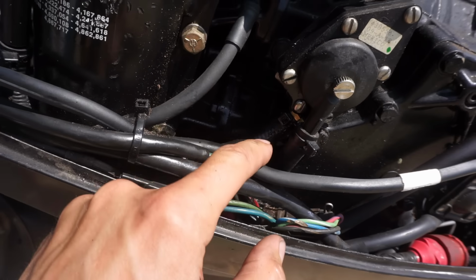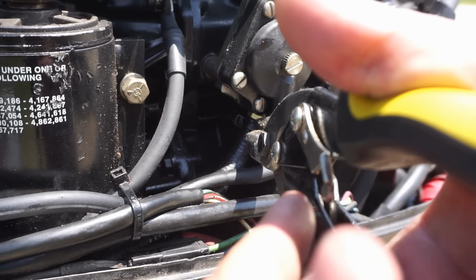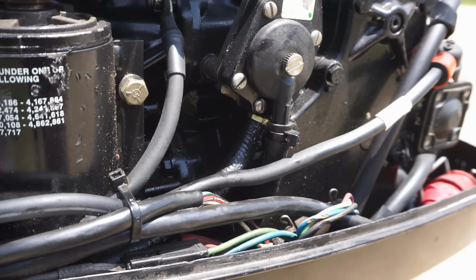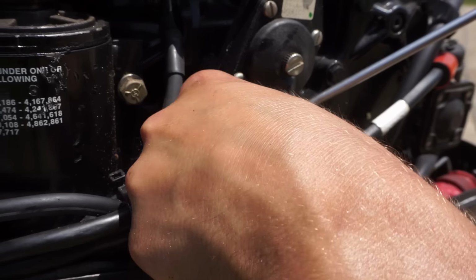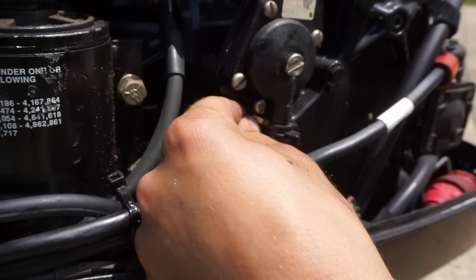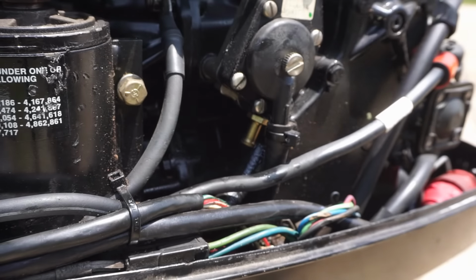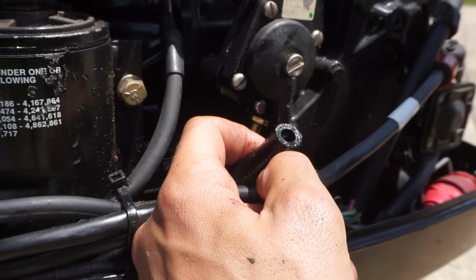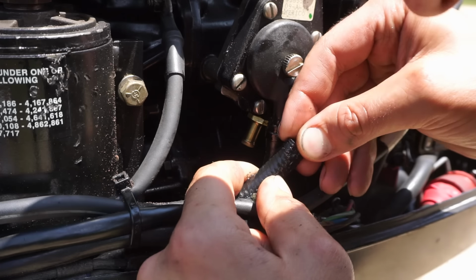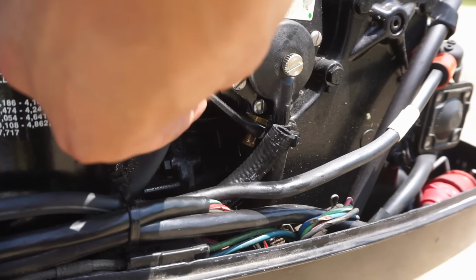So let's get a new clamp on there. Where that fitting is junk on there, I don't know. There we go. See it bubbling? All that gas coming out. Probably gonna spray me. I think that's loose in there. That fitting might be loose. Check the gas line for leaking. I'm gonna put a clamp on there. Yeah, that was pretty loose.